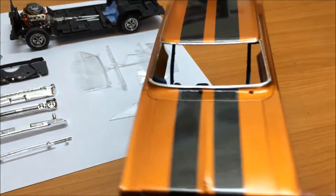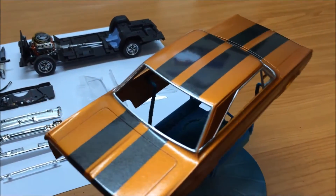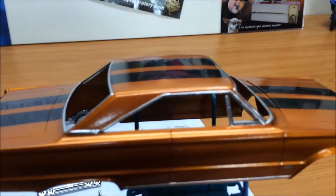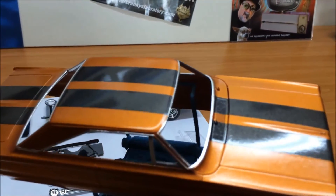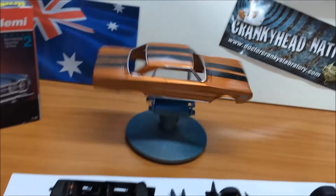So I'm just going to leave it as is, like that. I did my final clear coat over the top today, guys. I'm just going to let that cure overnight and come out, give it a light wet sand, do my polish and my wax. It's got a pretty good shine on it already, but I'll get it shinier, I'm hoping.